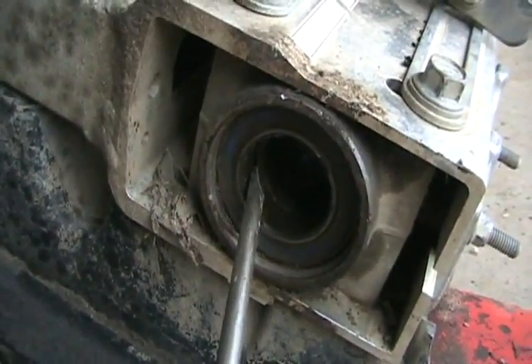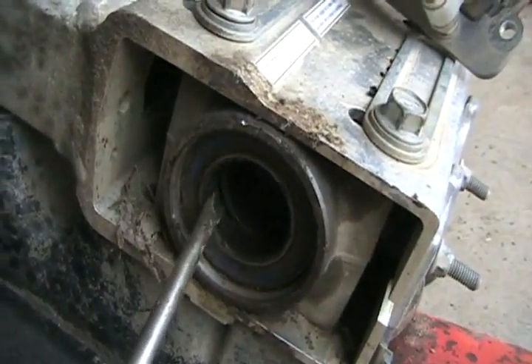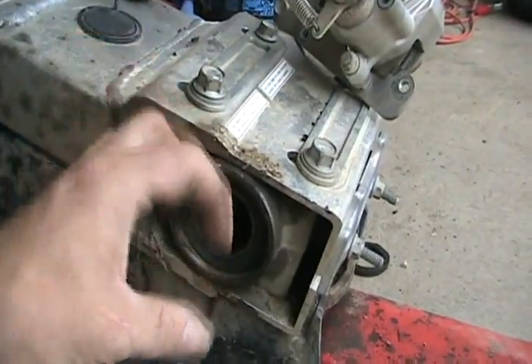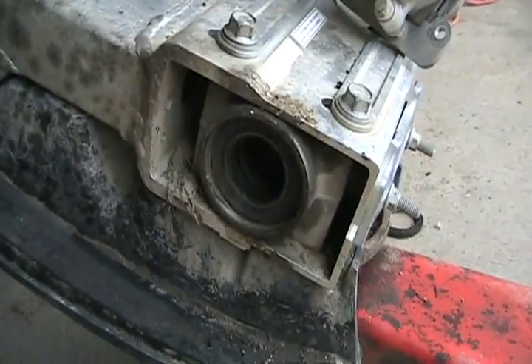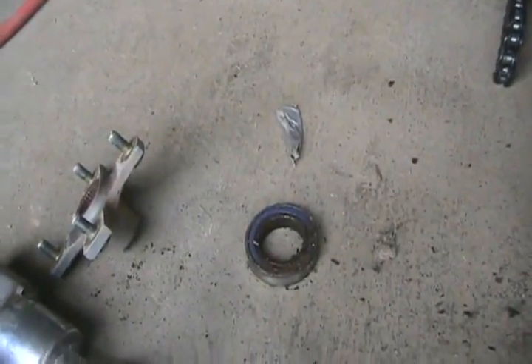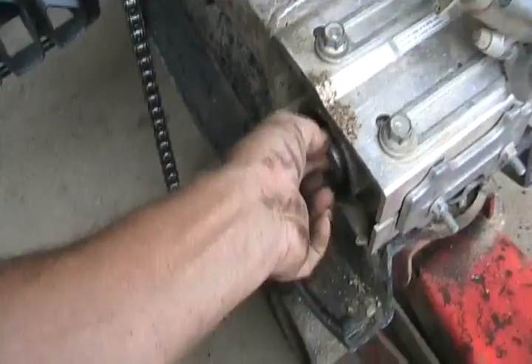There's a bearing spacing collar in there and you can move it to one side - it sort of floats around. I'm going to get the end of a bolt with a nice flat end, put it against that edge, and hit it with a hammer - hopefully it knocks out the bearing. I found an easier way: I just took an extension off my half-inch drive with a socket on it, shoved it through the hole, pushed down that little collar to catch the lip of the bearing, and gave it a few taps and it jumped right out. For the other side, put a big socket against the spacing collar, give it a couple of taps - that worked like a dream. There was water in there.